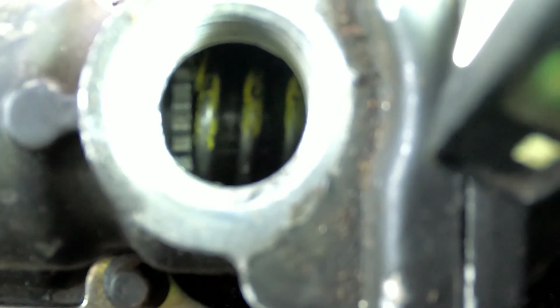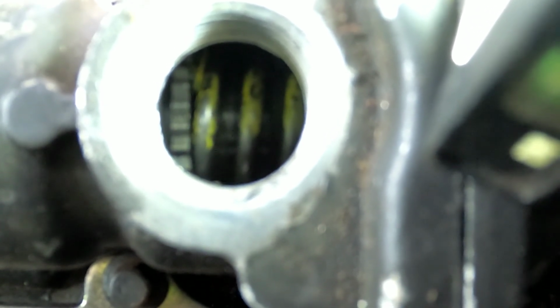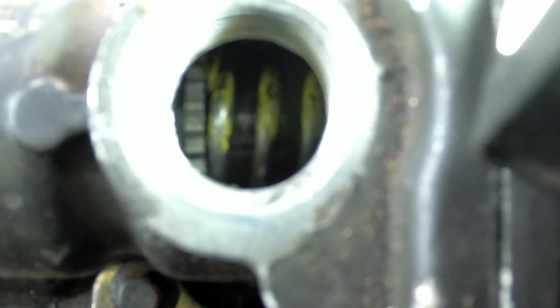So we've adjusted it pretty far back now where you can actually get to the star wheel. We can make our further adjustments if need be. And I think that's going to be a good starting point. If I need to, again, turn down, turn up, we have the ability now. We're not maxed out. So that should really help us on the fueling side at least.